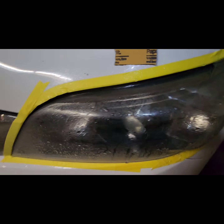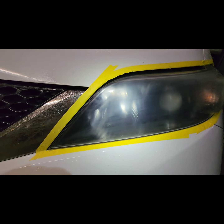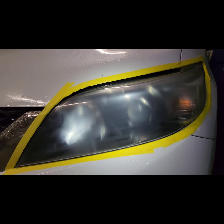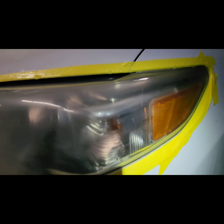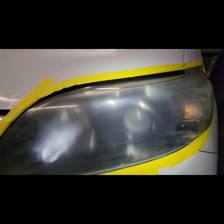You can use 800 or 600 grit if you want it really shiny and smooth, but 400 has worked for me. After sanding, it should look a little bit blurry right now because you sanded it down, but the idea is to sand all the imperfections, dust, and debris, and clean up the headlights. When you put the clear on it, it's gonna shine like brand new.